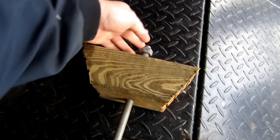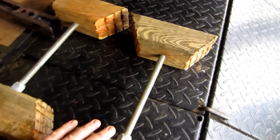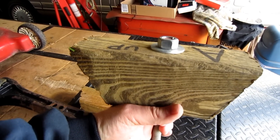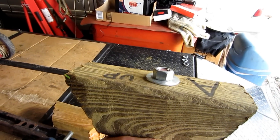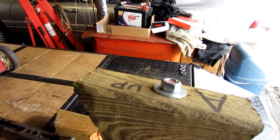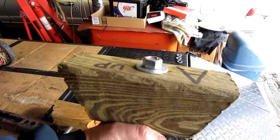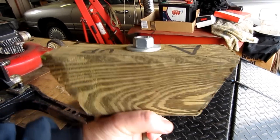Basically what you can do is leave these bolts loose and slide this in between your tires. I said I have 18 inches on each one of these for a total of 36 inches — if they were a little bit longer it'd be a little bit easier. All you need is a wrench. You just throw a wrench in your truck or in the back of your camper and snug this up. It doesn't have to be torqued down with great force, because all you're doing is making the tires work against themselves based on the traction applied to those grooves I cut on either side.